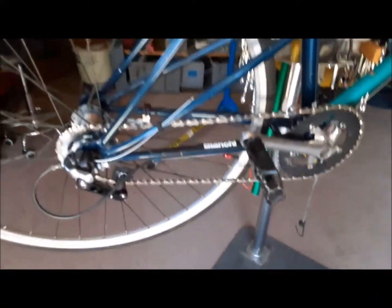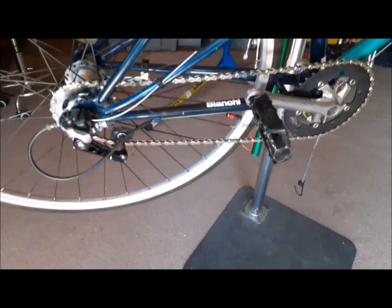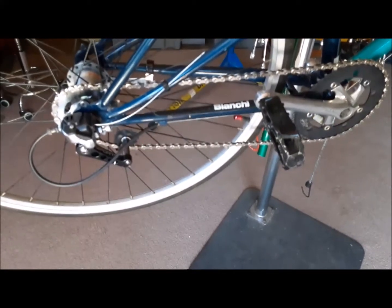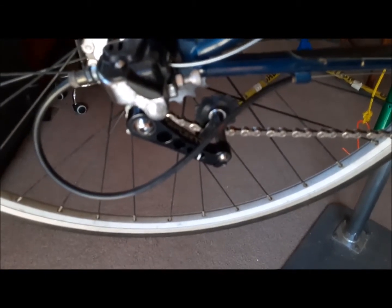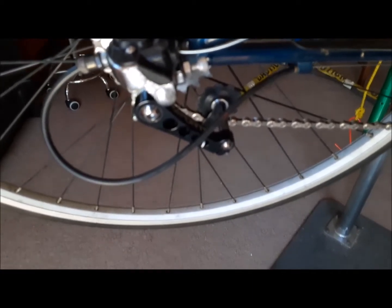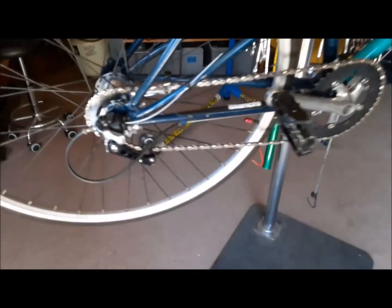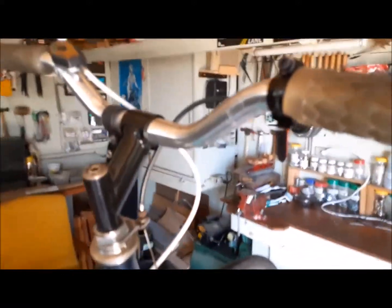How to do it? You put the wheel in, wrap the chain around, make it as tight as you can — just a little slack, working clearance — and you put in the tensioner, line up the pulley, line up the chain guide, tighten everything down, and you are done. You can ride three-speed — in this case a three-speed shifter up on the left handlebar, and a single brake lever on the right handlebar.